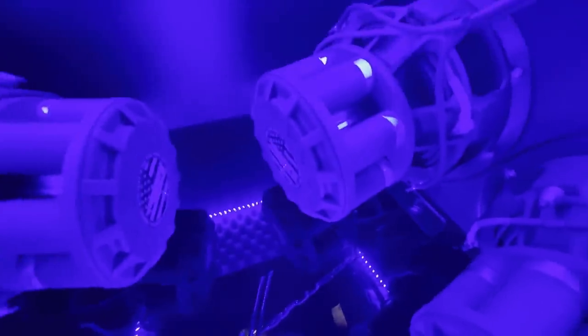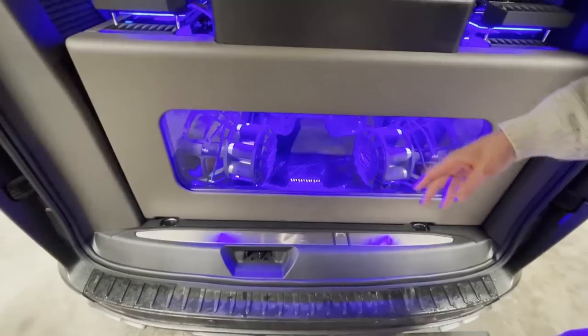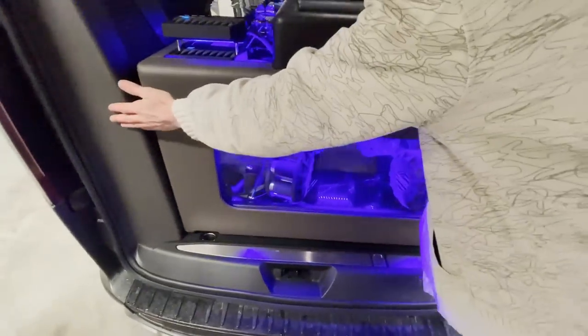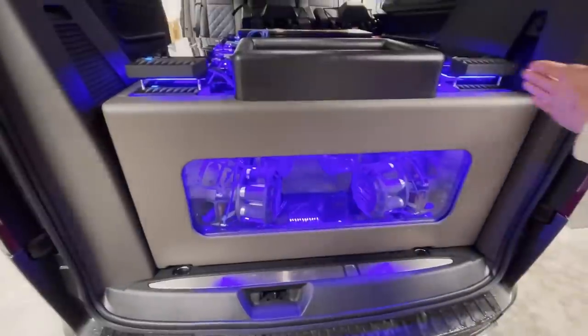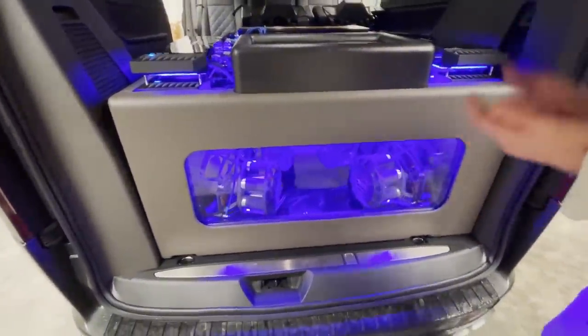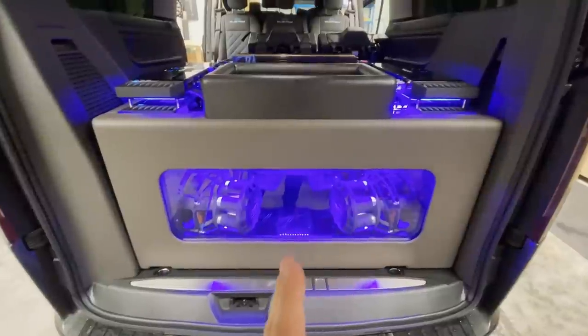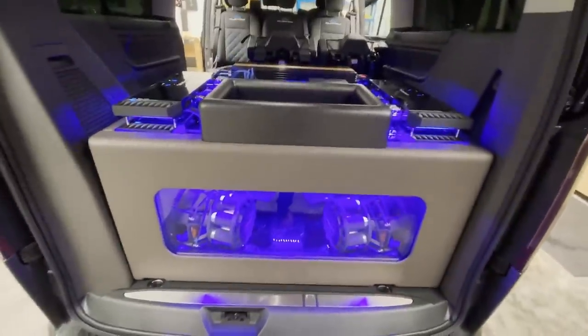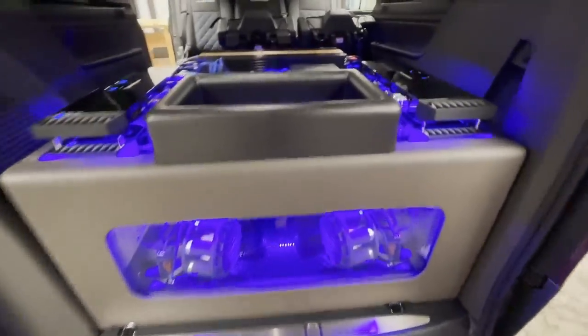Because this is lopsided, I had to balance the spacing either side of the chassis rails. And because of the internal aircon unit, this rear air handler unit, the whole thing shifted over, hence the offset. But it's M12 through the chassis. I didn't even notice that. You just stand in front of the build and everything is symmetric on the enclosure. You don't even see that offset. Yeah, it looks stunning.